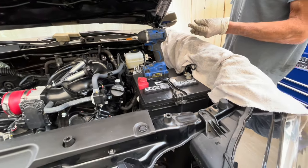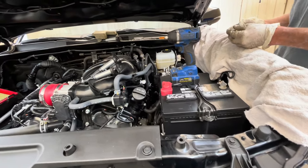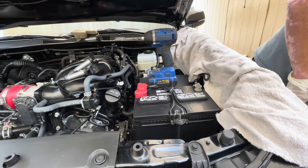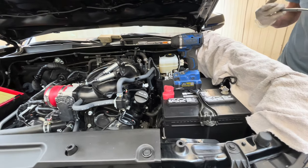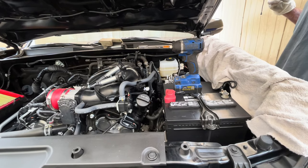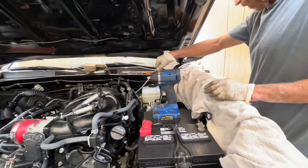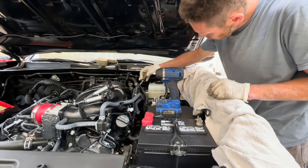How are those looking? Same. The engine's happy — no weird oil or anything. It's a newer Toyota so it's probably in good shape, but you can read the plugs to see if premature wear is happening. Like if there's a bad valve seal inside it'll start getting oily with a bunch of black soot on it.